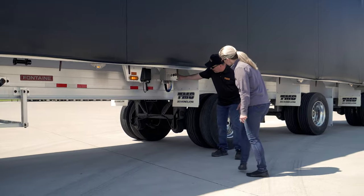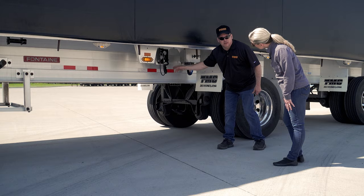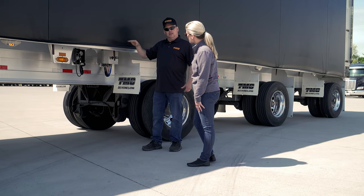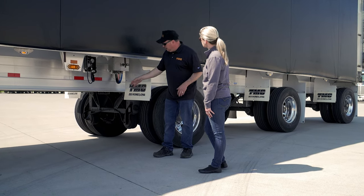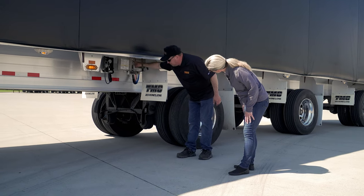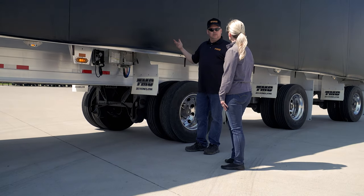There are actually two boxes on here. The first one is my weight gauges, and these weight gauges correspond with another one I have on the dash that'll kind of level everything out and tell me if I've got my weights close to being right. Then I've got this box here with a lever that goes up and down — that'll raise and lower the axle, and I can actually lock that axle up.